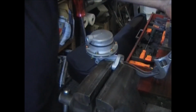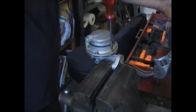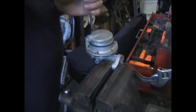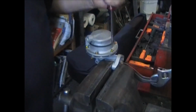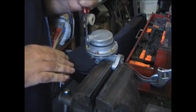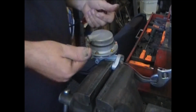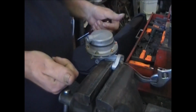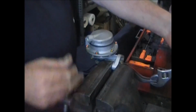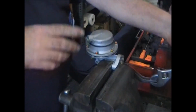If you didn't, you possibly could get a higher pressure reading. And also, when the diaphragm goes through its cycles, if you didn't preload it, it would be sitting up. You tighten the screws down while they're way out on the outside. As soon as this goes through its cycle, it tends to stretch them. It stretches out in those particular areas. Anywhere that there's a screw, it ends up tearing the diaphragm.